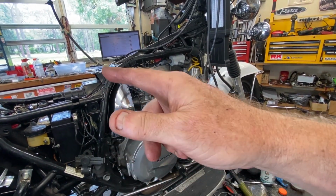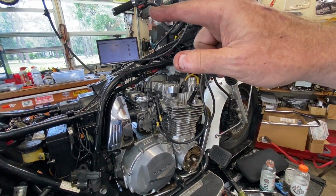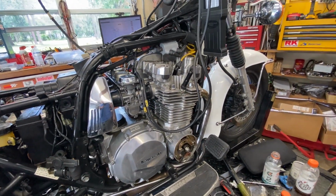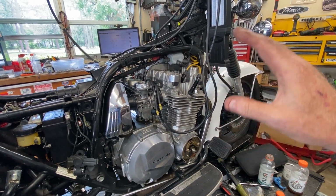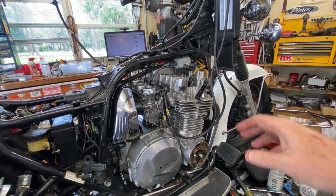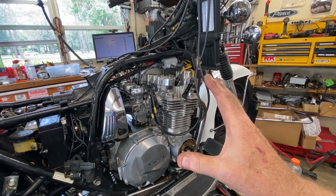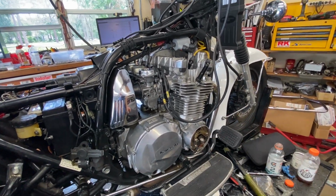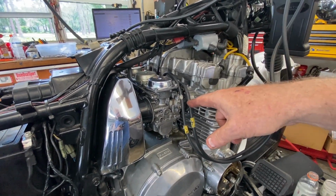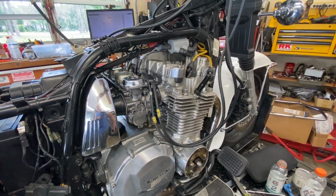It's more like this, at an idle, okay? Because of power, power, power, power, power, power, power. That's really what happens on any internal combustion engine, unless you had a huge flywheel on them for some reason, which smooths them out. I think that's one of the reasons why you have such large harmonic balancers on automobiles or the old V8s, to kind of dampen that. And we do have a flywheel technically sort of on the other side, which is the rotor, but it's not that much.